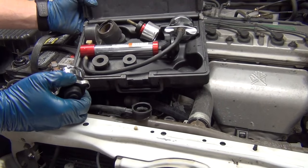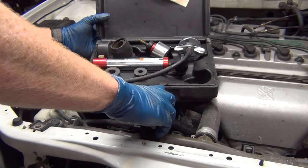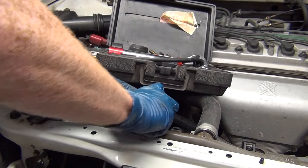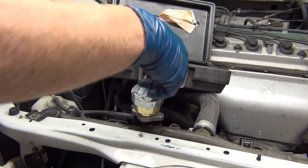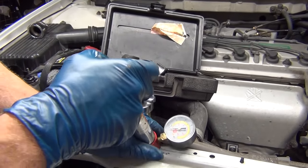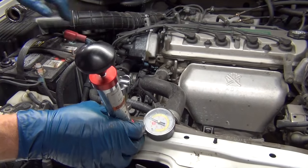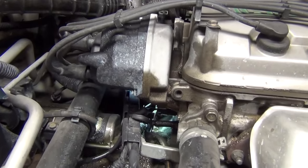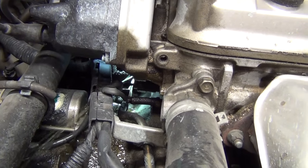But if you can't find it — if it's only doing it during certain times — what you can do is get a kit like this. I'll leave a link in the description. You've got all these different adapters; you just put one on your radiator, whichever one's going to fit, and then clamp this on. This one's off the tool truck, so it's a little overpriced — I paid almost $200 for this, but I found a better deal for you. Pump it up and look — see where it's just spraying everywhere? How could you not find that? It makes it way easier to find stuff. It's like an arrow pointing where to look.